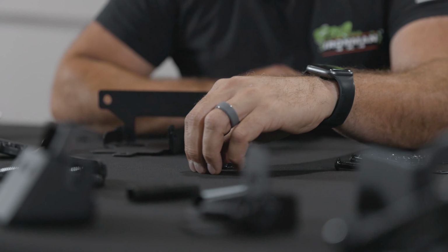All right, our wire harness is out. So I've got our parking sensor wire harness all cleaned up. I pulled out all these clips, kind of cleaned it up a little bit. And because we've marked all of our parking sensors in their position, it makes it easy for us to know what we're gonna do. So we're gonna pop this apart. We've got a provision here, a little cutout, so we're gonna run that wire under there. We'll do the same thing on the other side. Then we can click it back together.